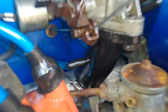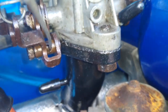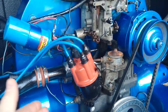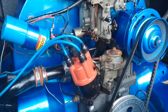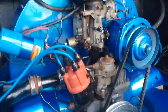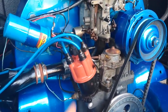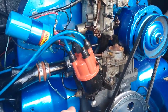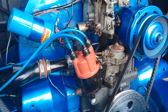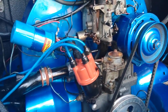I haven't looked up the base — there are numbers on the base of the carburetor right here. On the Samba, a gentleman has a thread where he listed those numbers and which ones would work with the single vacuum dual advance and which ones had to be used with the dual vacuum advance distributor. The distributors you can get now — you have the cheap ones and the $150 ones — and I thought, if I'm going to spend $150 and possibly still have the same problem, I might as well do something different.